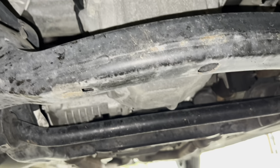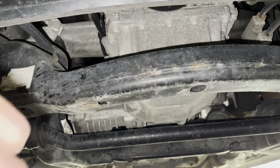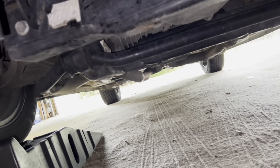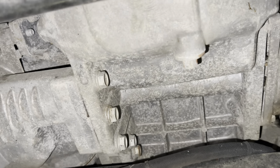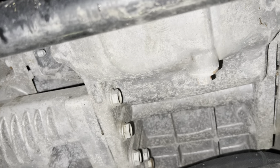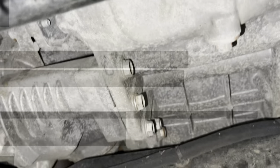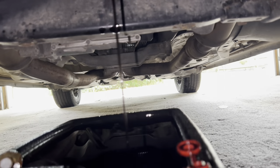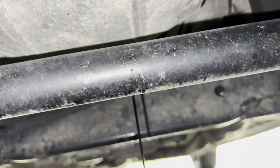We are now underneath the car. Unlike the Mazda, we don't have that big plastic cover on the underside of the engine bay, so no extra steps there. All we have to do is find the oil pan — there it is — and there is the drain bolt. In this case it's a 13 millimeter, so we're going to crack that loose, get our drain pan under here, and drain the oil. That is draining, so we're going to let it drain for a few minutes and then move on to the next step.